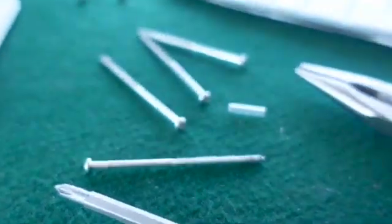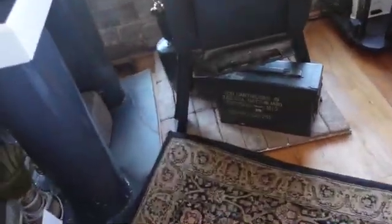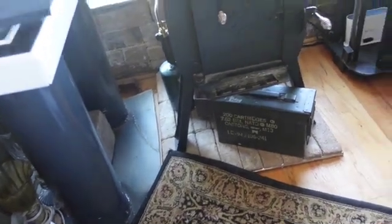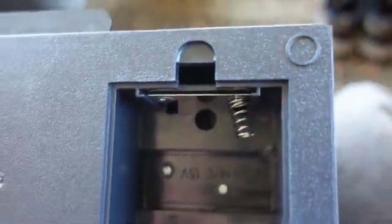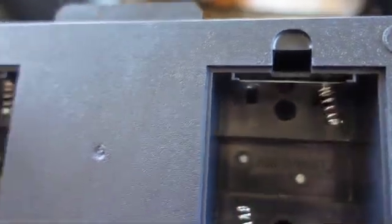But anyway, then I took out these big long screws, and I'll show you where those are. There's a couple screws you need not take out. These 4 screws here you need not take out because that holds the tower. You'll see in a second. But the long screws are down in here. 1, 2, 3, 4. And you get them out of there. Have a magnet handy if you want to be nice.